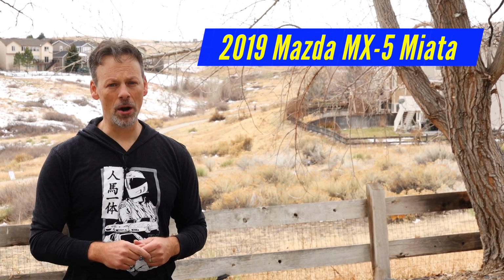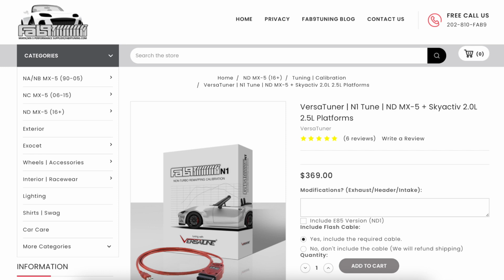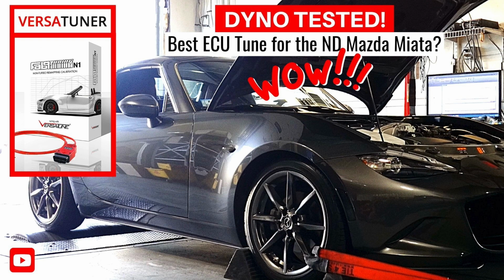In today's video, we're going to take one of our project cars, the 2019 Mazda MX-5 Miata RF, back to the dyno for some additional testing. So a while back, we tested the VersaTune by Fab9 Tuning. That is an ECU tune in which various parameters like ignition timing and fuel are adjusted in an attempt to gain more horsepower and more torque. And like I said, we've already done this. We did this a while back using the 93 octane off-the-shelf tune by Fab9 at sea level.